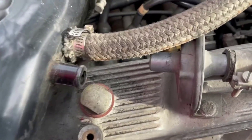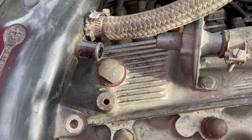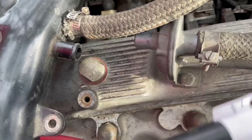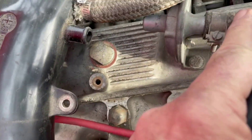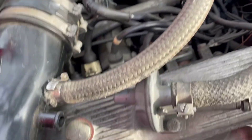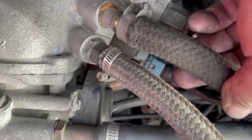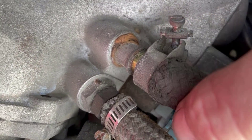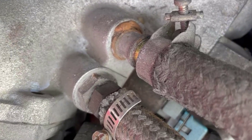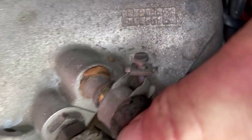This large fitting here is the auxiliary air device — you can see the hose that came off is quite a big diameter. This is where we use hose F, which has a good-sized diameter to slide on and connect here and then down below. As we remove the large-diameter hose from the auxiliary air device, you can see it's completely perished — just falling apart and cracking on the inside. What first looks okay turns out to be coming apart, and air could actually be getting in through this section.